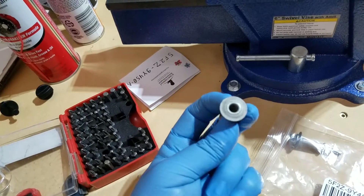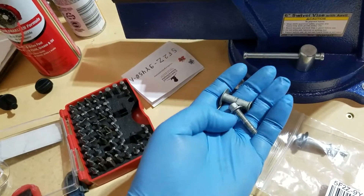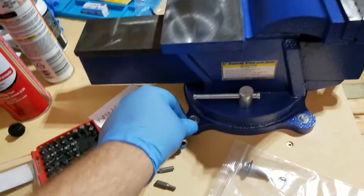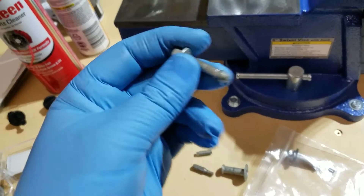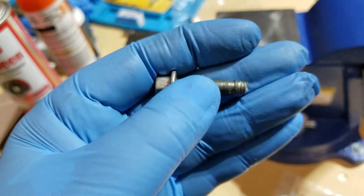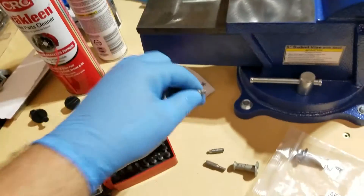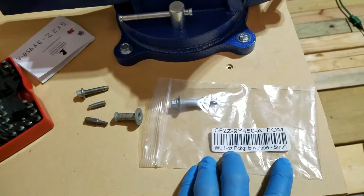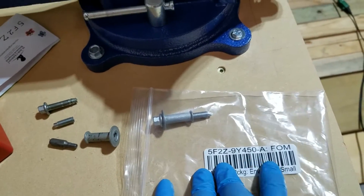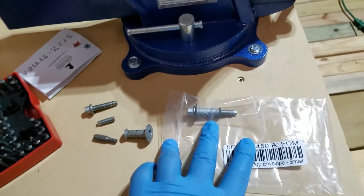This part was stuck in the intake manifold — it has catch sleeves that hold it in. Once you get it out, you can just knock them out of there, because on the bolt there's a ridge that holds it in place, but it's not too deep so you can just snag it out. I'll put the part number in the description — you can order it from Ford or buy it online from different vendors.